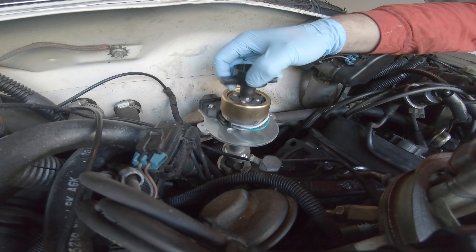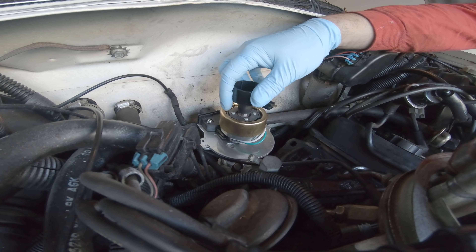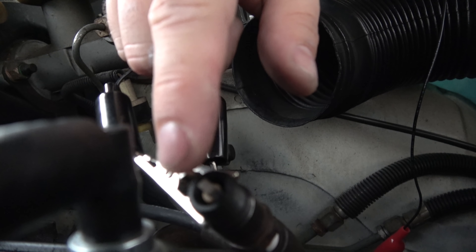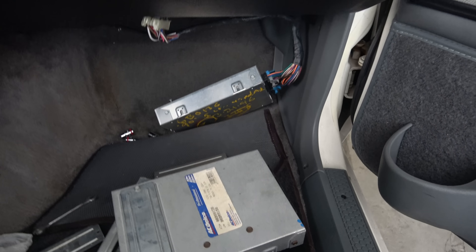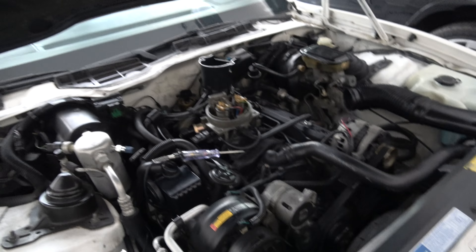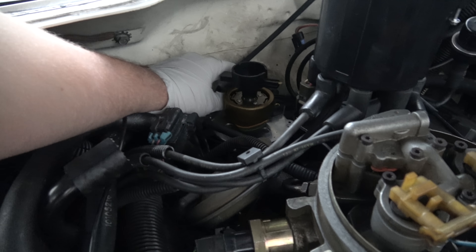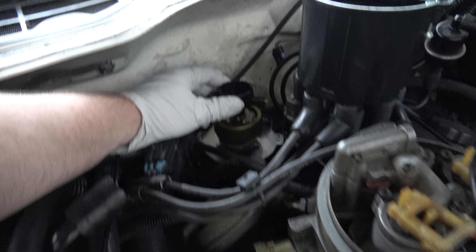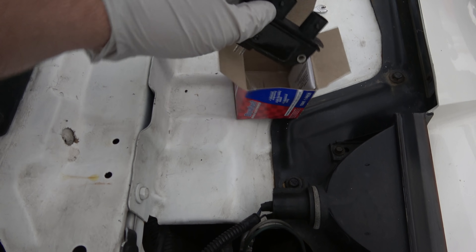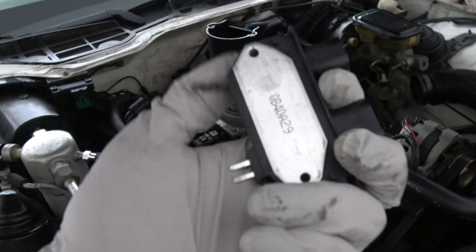If it had happened out there in the wilderness, who knows — I could have been beset by bandits from the mountains. The car died and I couldn't figure out what it was. In my mind, there was no way it could be any of the new parts I'd bought. So I ended up buying a new coil since I wasn't getting spark. I thought it might be the coil, the PCM, various things — but definitely not my brand new distributor. So I went through and replaced a whole bunch of unnecessary parts, loaded up the parts cannon and fired it at the thing. Turns out it was the new distributor — specifically the ignition control module inside of it that was broken. The only way I could figure this out was by eliminating every other possible cause. To make matters even worse, the car had been running fine with the new distributor for about a month before it just died, which made it even harder to diagnose.